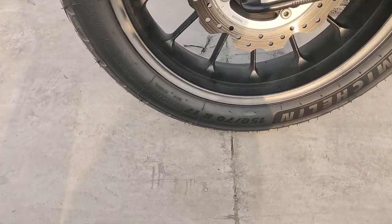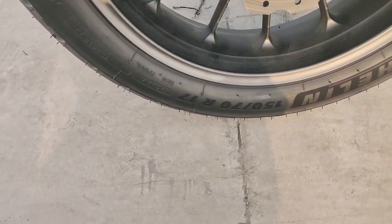The issue here is tire pressure. Honda recommends for the rear tire, which is a 17-inch tire, a tire pressure of 280 kPa — that's 2.8 bar. For the front, which is a 19-inch rim tire, it recommends 200 kPa, or 2.0 bar. So those are Honda's factory recommendations for the CB500X.